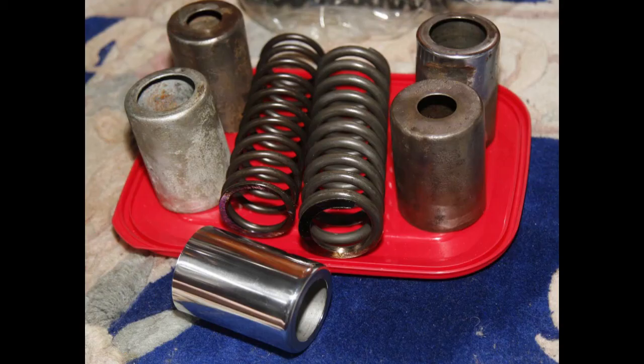Yeah, so the last photograph is of the plunger springs. So obviously in the pictures that went before, you've seen the main sliders and the shafts. But obviously when they go back together, finally, they'll need the springs and spring covers. We made a batch of the springs last year. You can see the largest spring on the right is the compression spring, and the smaller spring on the left is the rebound spring, quite different gauge.